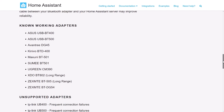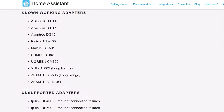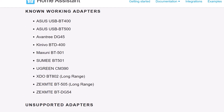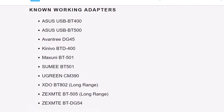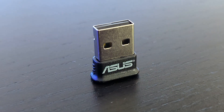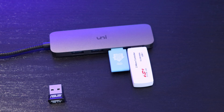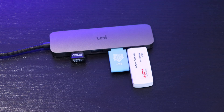The first thing you need to do is plug in your USB Bluetooth adapter, or enable the Bluetooth setting in your BIOS if you've got one built into your Home Assistant server. There's a list of known supported Bluetooth adapters listed on the integration documentation page, which I've linked in the description below, and I strongly recommend that you buy one of these if you're in the market for a new adapter. I bought an Asus BT400 adapter to use with my setup and connected it to a USB hub on an extension cable so that it doesn't succumb to interference from any USB 3 ports or onboard Wi-Fi.